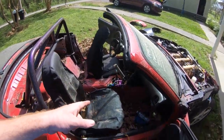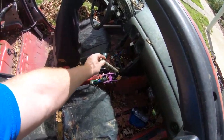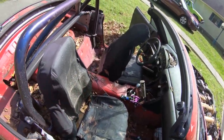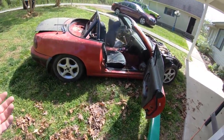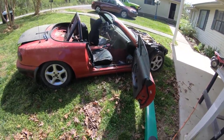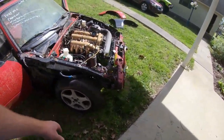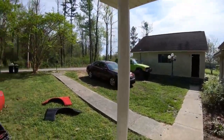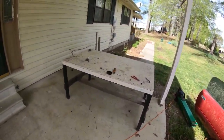It does have a hydro brake but it's not bolted down — it's just hanging there. The lines run to the back. I'm taking the seat out to see where the lines run. I'm probably going to lift the car up a little bit because it is sitting on the floor — so low that the tire keeps rubbing, and it's showing wire on both sides. I also found out the brake reservoir cap was missing and they had a makeshift cap screwed over it to keep pressure in the brake lines.